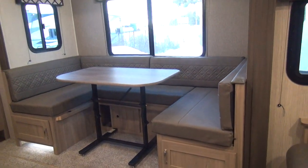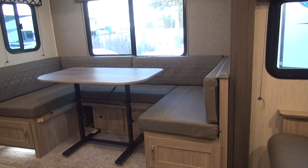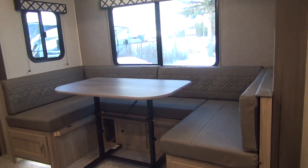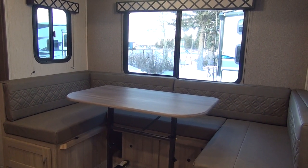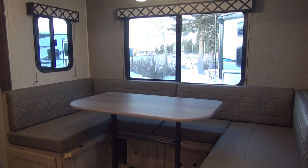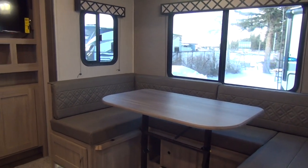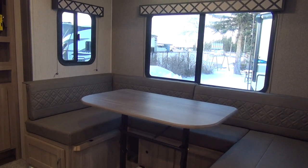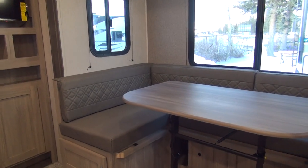The U-dinette is set in the slide-out, which is a full-depth slide-out. This is an electric rack and pinion system — it's a really proven system that's been on the market for a very long time and has been pretty bulletproof. It does have moving parts so it can have factory defects or wear out eventually, but in 20 years of experience, this slide system has shown very minimal recurring issues. It's usually just an adjustment or a motor problem when something does go wrong.